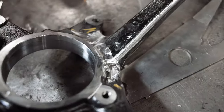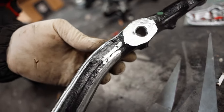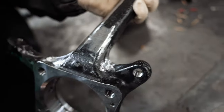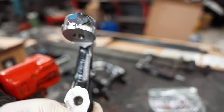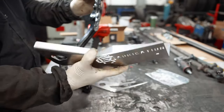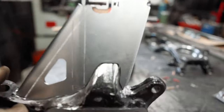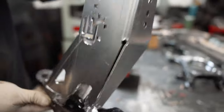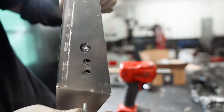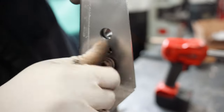Your spindle should now look like this — bare metal all the way up and around at the top, then back down all the way around at the bottom, and up here at the top as well. Now we're going to show you how these puzzle pieces go together. The first one is the main one with the RC Fabrication logo — we're going to put that on the outside. You can see it goes right around the spindle down at the bottom, and then we put the brake line bolt in to hold it in place to confirm it's lined up.